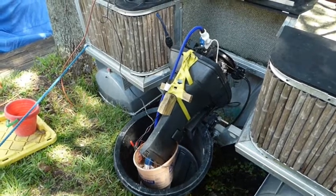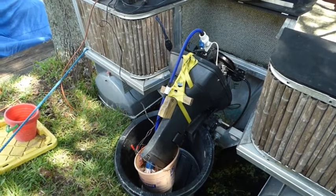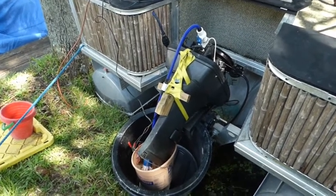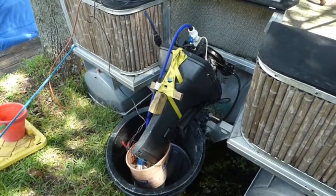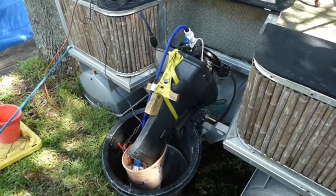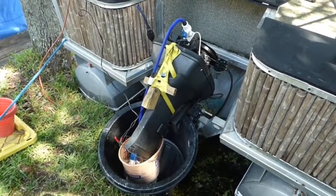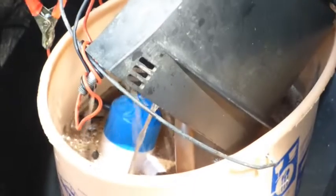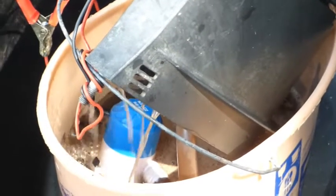I never had a good water cooling stream, but I thought as long as it works... now it didn't work two days ago. So now I am flushing the engine with this White Lime stuff. For that, I have a bucket with a little bilge pump — it's a 3A bilge pump. The bilge pump is connected to the pipe coming from the water pump.